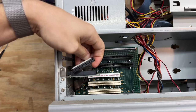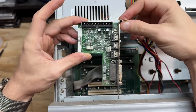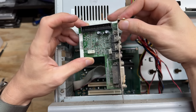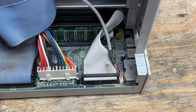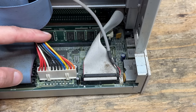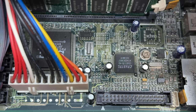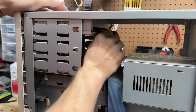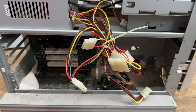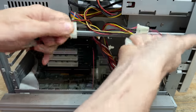That's a weird looking thing — I thought it would be all traces, but we got at least one active component on there. That is interesting. I guess the real brains of the operation are on the motherboard itself. And this thing uses DIM RAM, so it must be newer than the first system — I thought it must have been older, I guess not. And there's the sound chip — that's the CS4237B-KQ. Let's start getting stuff disconnected. And they made a real mess here — let's snip this zip tie. The VRM has its own dedicated fan, and the heatsink is only about two-thirds of the height of it.